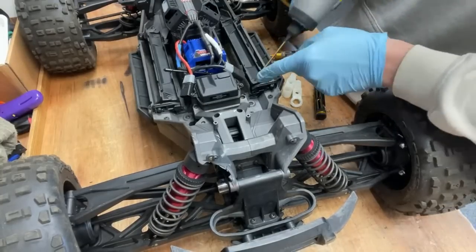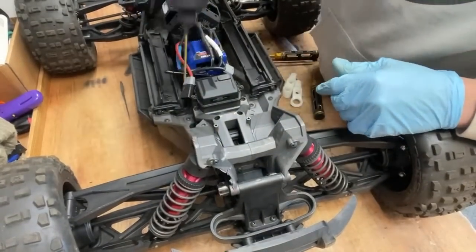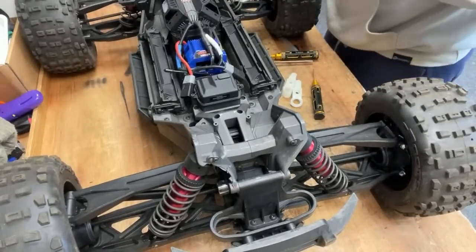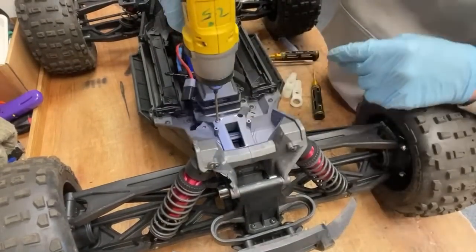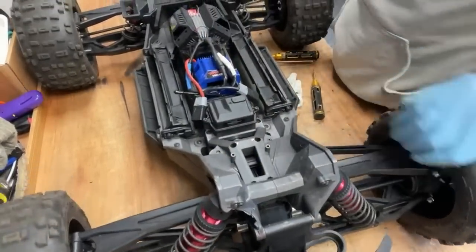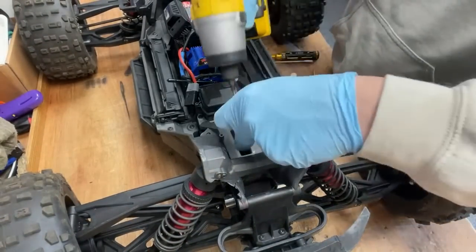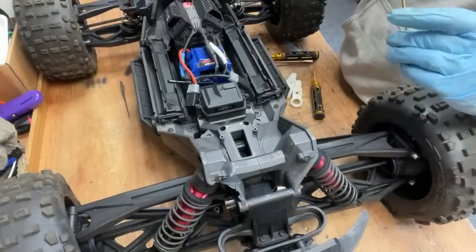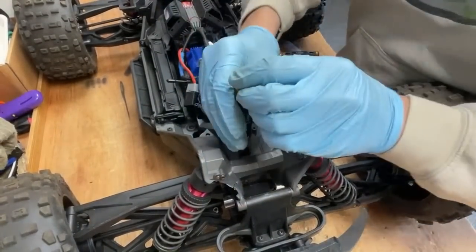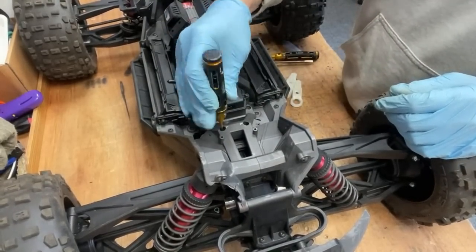When are you going to fix the Losi DBXL? Oh, I'm going to start on that in a minute, actually. I'm not going to do it live, though. I'm going to put the Taylor 35cc engine into that one. I've got to send that engine back because he's going to give it a V2 conversion. In the last video where I ran it, when it was in the Losi 5, I bashed it a little bit and then it started bogging, almost like it was going lean, but it was running good before. So I'm just going to send it back, let Taylor have a look at it, and give it the version 2 conversion. I snapped the fuel nipple off the carb as well, trying to work on it, silly me. And then that engine's going to be the DBXL in the Losi.